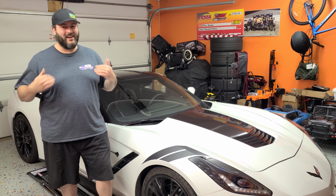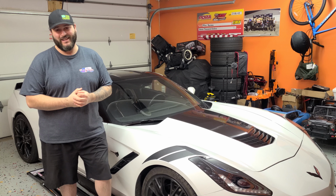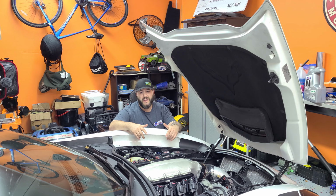Welcome back to the hangar. I'm Mike, and I'm the only Mike for the day. It's nice to have a little freedom. Today in the hangar hideout, we're gonna be swapping out my intercooler on the C7 Corvette. The one on there is all right, but it's a little restrictive between inlet and outlet. So we're gonna be swapping out for an air-to-air Procharger intercooler that should flow a lot better.